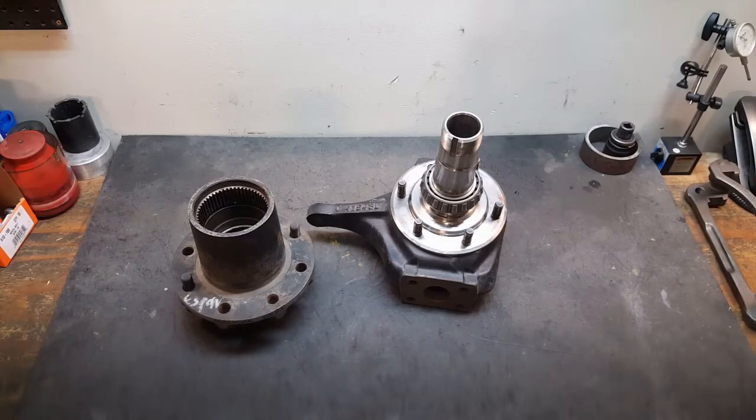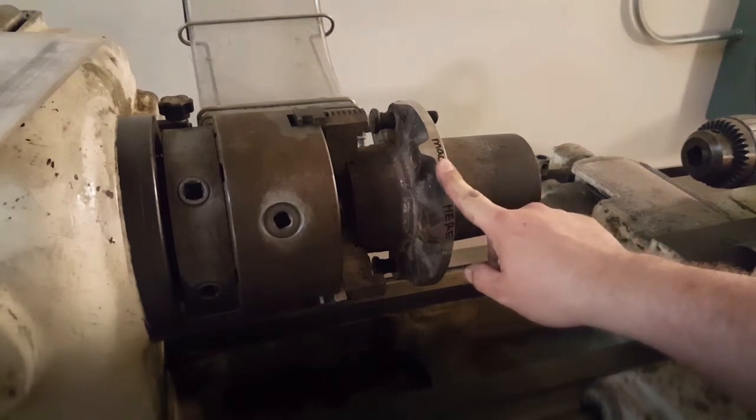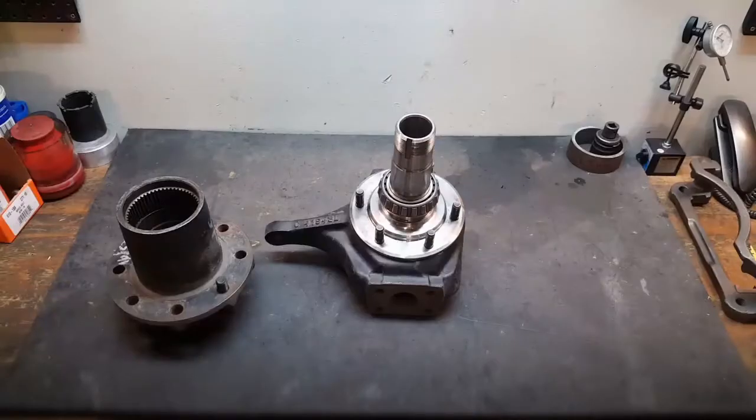In preparation for putting this kit together, the first thing you're going to want to do — and we're doing this on the workbench for the ease of making this video — you're going to want to tear your brakes off and take your knuckle down to basically the spindle installed on the studs, and take your hub off. Next you'll need to get your hub to a machinist, or if you have a lathe, you'll need to machine the perimeter on the hub down to seven inches, eight hundred and fifty thousandths. The reason for machining the hub is to allow the new Dodge rotor to slip over the top of the hub rather than mount behind it in the OEM configuration.